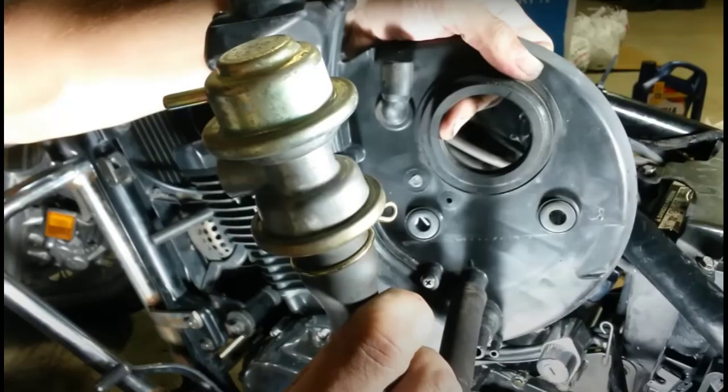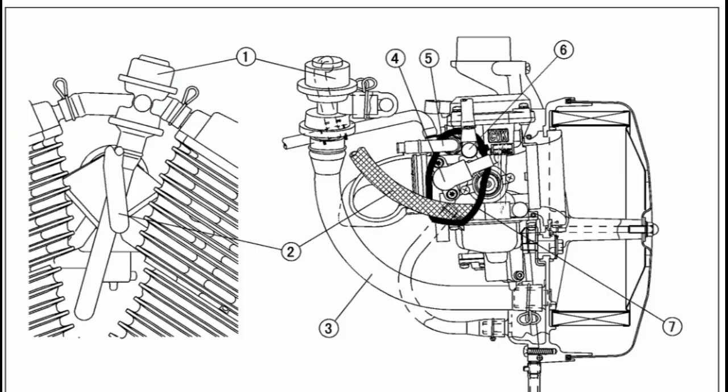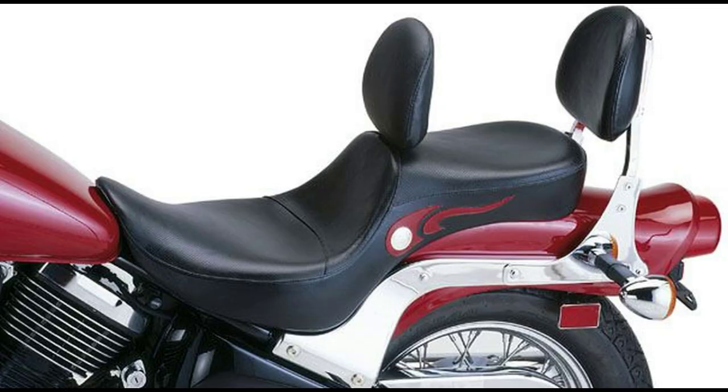The other thing that is usually done to them is the removal of the secondary air system or the PAIR system. Now, that is the clean air injection system that delivers some air into the exhaust manifold right next to the exhaust valve, and that makes the exhaust run hotter, which wears the exhaust pipes out a bit faster. Usually after 20 years these don't work properly anyway, so this modification is not a bad idea to do. And there are YouTube videos regarding this. Check out links in the description of this video to get those links.